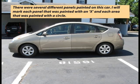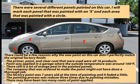There were several different panels painted on this car. I will mark each panel that was painted with an X and each area that was painted with a circle. There could be a few reasons why the new paint on this car didn't perfectly match the original factory finish. The primer, paint, and clear coat that were used were all 1K products. Paint was applied in a garage where the outside temperature was around 100 Fahrenheit.